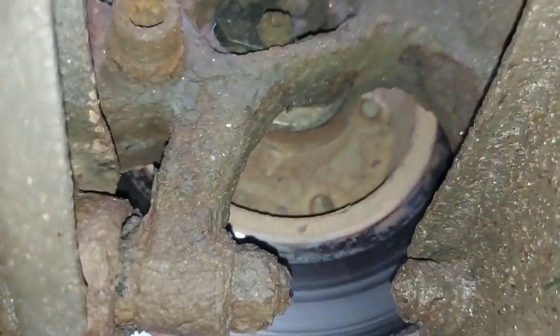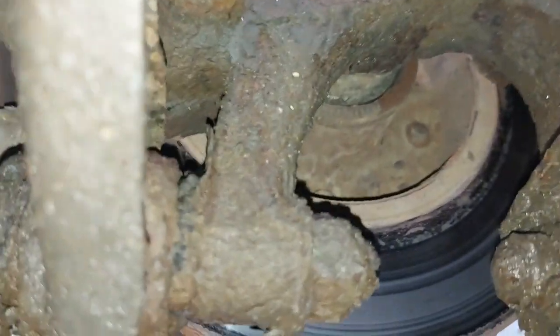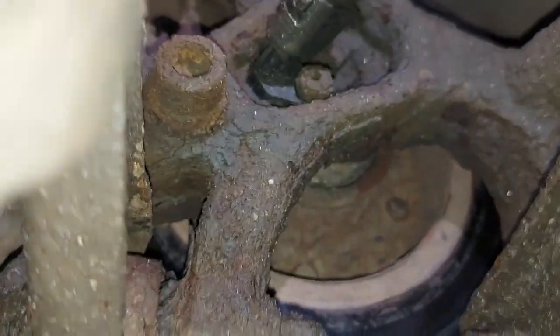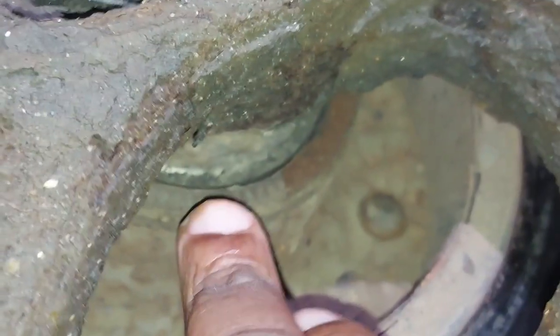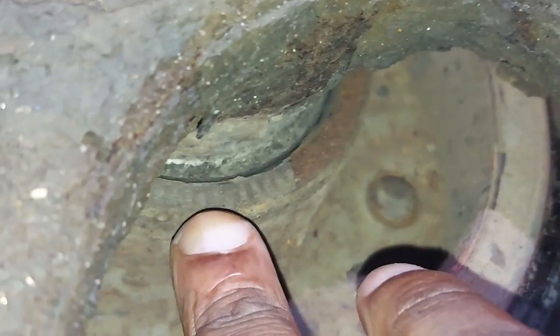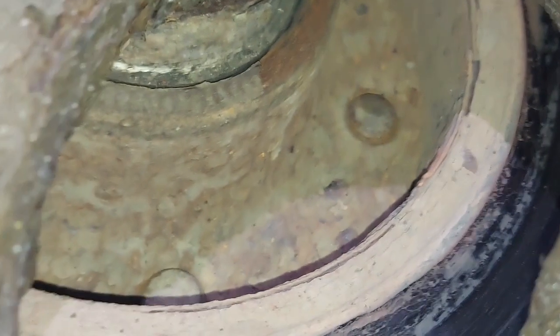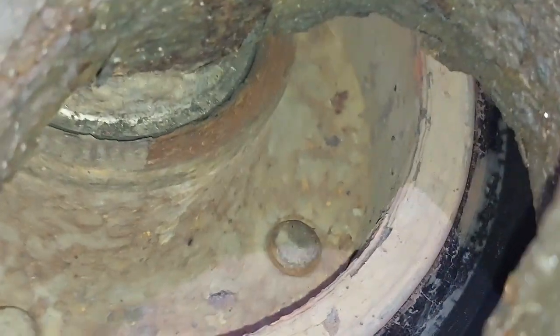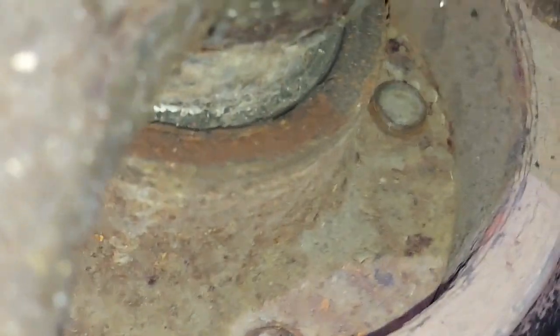Right guys, so this is the wheel in particular that is giving us that trouble code. The light is not great, so let me zoom in a little bit. You can see in here where my finger is, that's the ABS reluctor, the wheel speed sensor reluctor. If you check that brown part, it means that it's missing, it peeled off. Because of that, we have this trouble code.